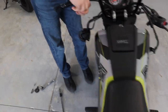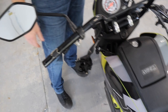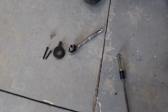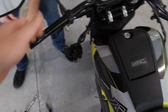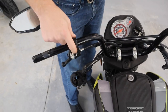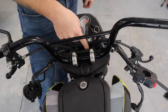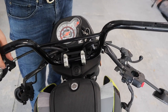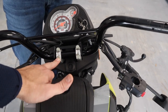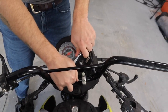The mirror and the brake lever are now off. Since I'm not keeping the factory bars for resale, I just took a razor blade, cut the handle off, and was able to get the choke lever off. If you notice on the bottom, it doesn't clamshell apart — it actually clamps down. The easiest way is to undo the four bolts for the handlebar and slide the handlebars off because you don't have enough real estate with the cable there. These are four 10 millimeter bolts.